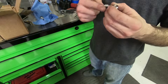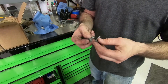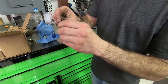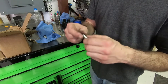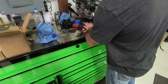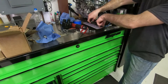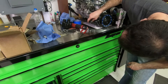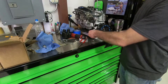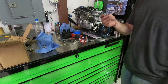Let's put anti-seize on it so it can't corrode - water and metal on exhaust. You'll have to cut it too because the shank is pushing. As long as this isn't longer than... but you have that thick washer that goes right here. Those go in the hole - probably can't be any longer. That thick washer would work right there. Those inserts are really deep, you don't want to break one.